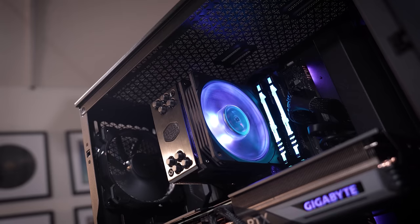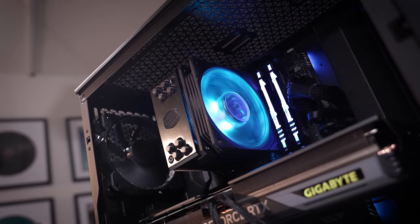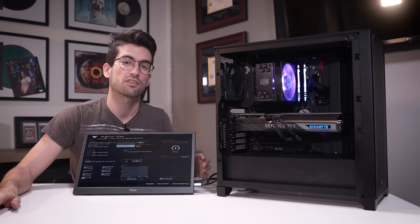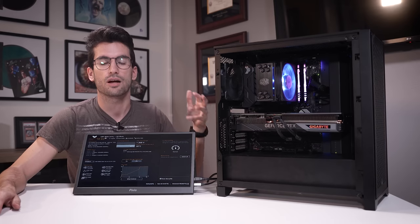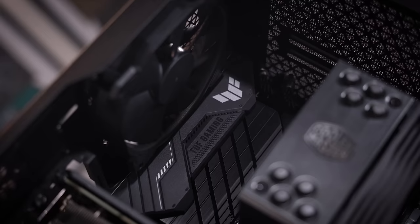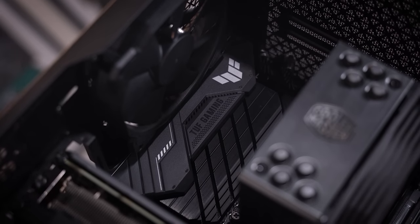And yeah, I mean, this ultimately just came down to an unfortunate instance where you need a previous gen CPU to even upgrade the BIOS to use the latest gen CPU that you wanted to use in the first place. This has been the case for several years with AMD. And up until recently, being able to flash a BIOS or update it without having a previous gen compatible CPU just hasn't really been possible. With BIOS flashback now, a lot of newer boards, a lot of more expensive boards, frankly, will have that capability. You can flash without a CPU at all.